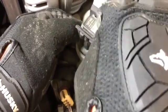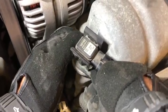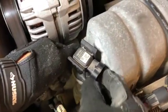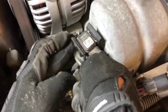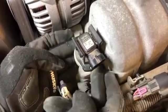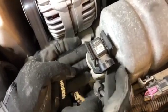Just make sure that you're connecting the cogs on either side, this cog here, with the slot, because what you want to do is push this down and then rotate it slightly clockwise. So we will be pushing this down onto the cogs. Again, be careful, it's quite a delicate housing. Then we rotate the whole assembly clockwise once we push it down. There we go, and that's on. Double check: we've pushed it down, we've rotated it, and now it's connected.